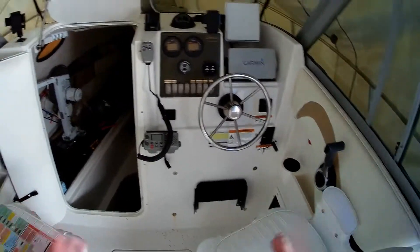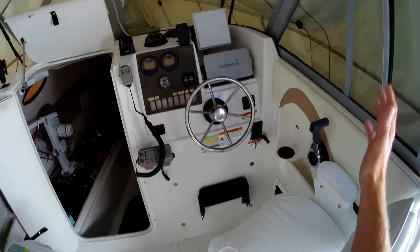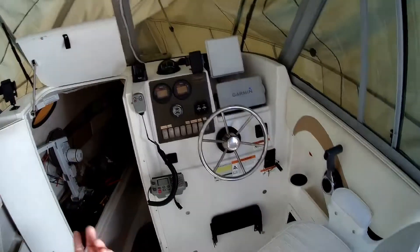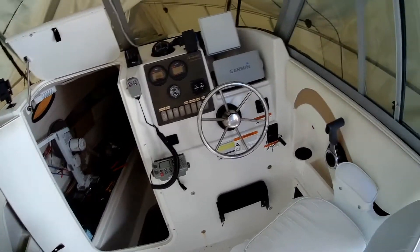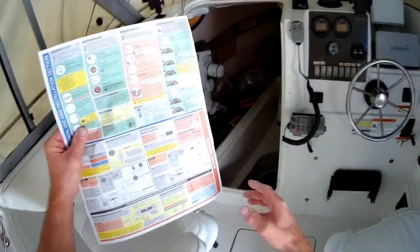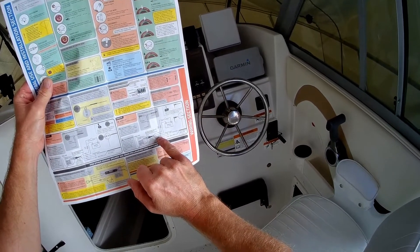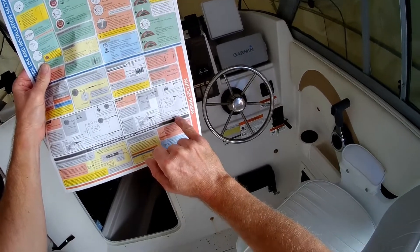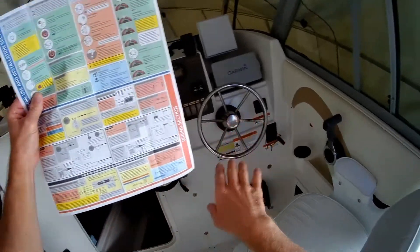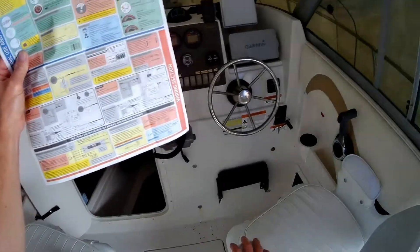They use great electrical connectors with heat shrink, so I used my heat gun to shrink the connections in place. My only gripe so far was the wire length — they were pretty short. I went and picked up some 16-gauge wire in white and black, since that's what comes off my ignition. The gray wire attaches to either black or white — mine uses white — and the orange wire attaches directly to black. Very straightforward.